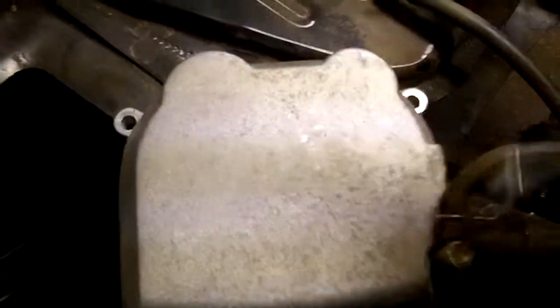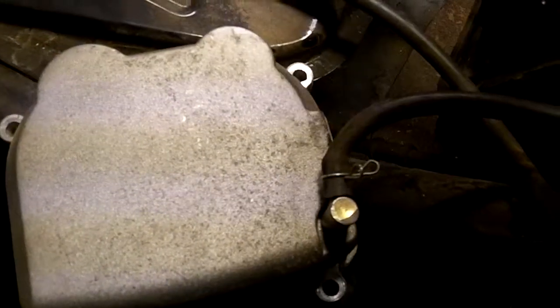This took me about 35 minutes to tear it down to this point, so it doesn't take long. You've just got to take your time and know how things kind of slide together and snap together. This has got these little snaps — they look broken but they're not, that's just where they missed it with the paint. We've got the valve cover off. As you can see, just four 8mm bolts. The engine's set at top dead center. We have a timing mark here, a timing mark here, and a timing mark here.